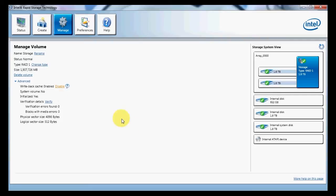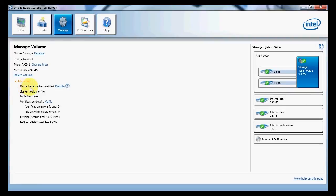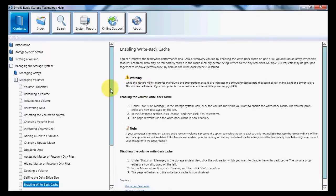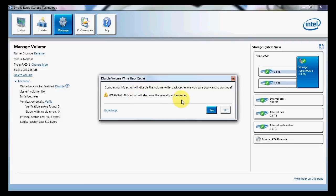It's time for the grand finale. The second pair of hard drives didn't do any better — they were less noisy but just as slow. So it has nothing to do with the brand; it looks like it might have to do with the cache size. To fix it I had to go to the Intel Rapid Storage Technology, which is what you use to set up the RAID. In the storage system view you can select the disk, the volume, or the array. On the volume you can go to Advanced and find the write-back cache setting. The help text says this makes everything a lot faster, but the only risk is that if the power goes out you'll lose data. It turns out this was the problem — I had to disable it. It gives you one last warning that this is going to make everything work worse, but I said yes anyway. And that's made everything work so much better. Now it's good. The end.